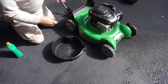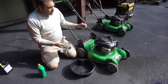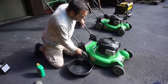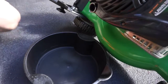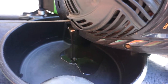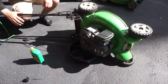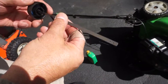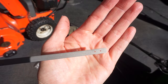On this particular model there's no drain hole, so we just have to drain it from the fill hole. We'll just tilt it on its side and the oil should come right out — and there you go. It takes a couple minutes to drain, so we'll let that go for a minute. While it's draining, this is the oil dipstick tube — you want to fill the oil up between the two dots, which is the correct amount to run your lawnmower on.